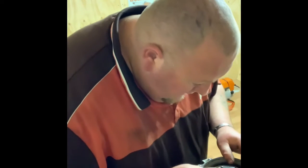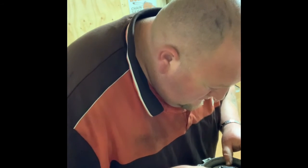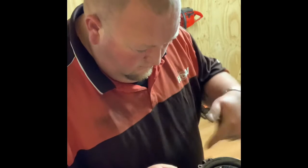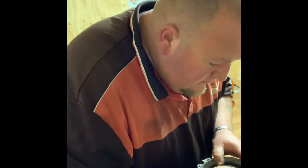As for these, well, there's the timing mark. Okay. There. There's no mark on the plate itself. This was advanced, I think. The last one was in the middle. There's no mark on the base plate of the ignition. So there's no mark to cross-reference with, unless it's the corner of this here. But that should be right there. Well, we'll go there. It's no big deal, really.